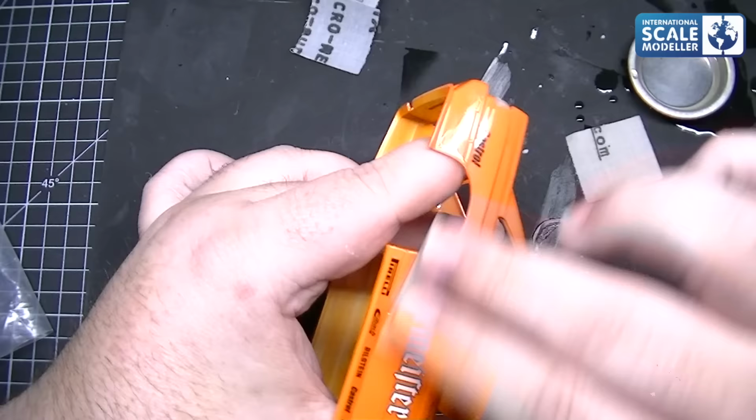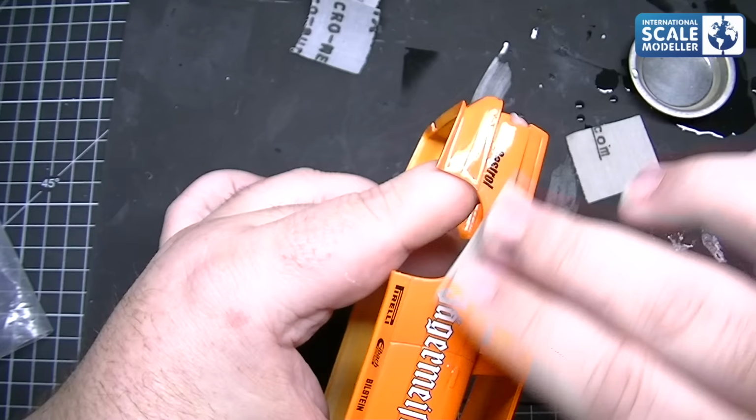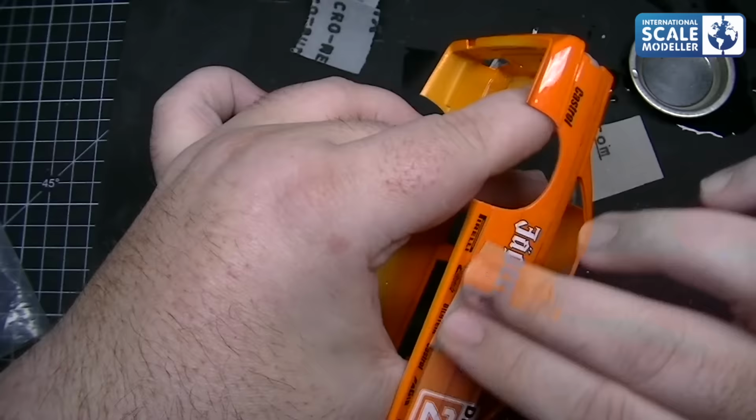So now we're onto the side of the body. I'm going over this now with 12,000 wet and dry, the way I always do. We just flattened it off ever so slightly. It was a really good finish out of the gun. We did get some what looked like slight orange peel after the 2K dried. So it wasn't as flawless a finish as we had out of the gun. And I did say that during the review. We'll know once it's dried and see how it flats.